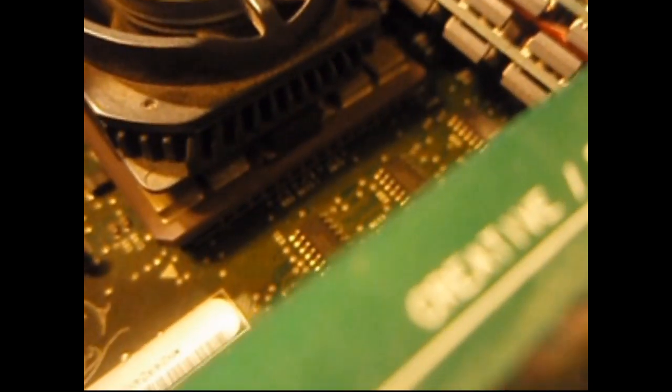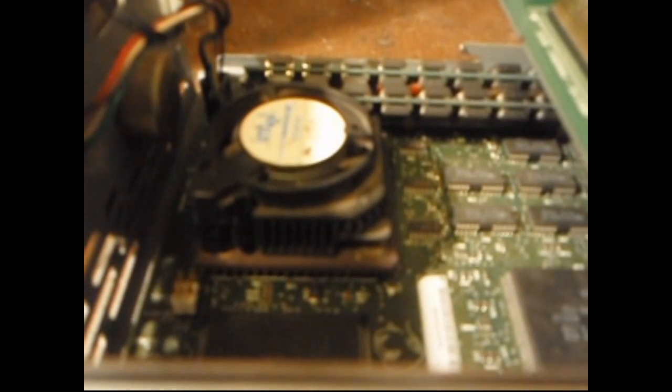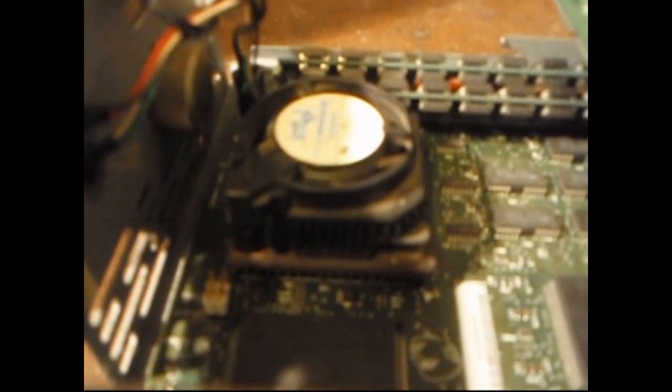If you look real careful, you can see that the pins are hanging over the socket and not quite touching the motherboard. Those extra pins in the extra row, which usually requires a socket 2 or 3, are all for voltage. And it turns out that if you just jam an overdrive processor into a socket 1 motherboard, it will work and it doesn't really give a shit.